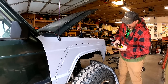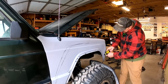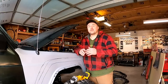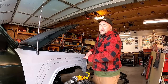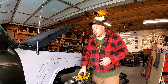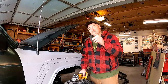I'm going to lock this down at two inches, take my Sharpie, and just give myself a line of where I want to cut. You can cut these fenders out with sawzalls, hacksaws, whatever you feel comfortable with — plasma cutters if you have one, torches — just pay attention to the backlash of the fire. I normally like to use a cut-off wheel. And I'm going to use my safety glasses — just kidding about the safety squint, I'll get my safety glasses.